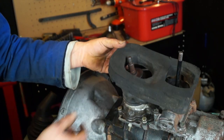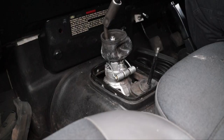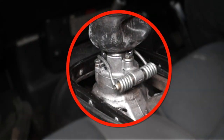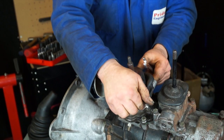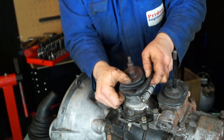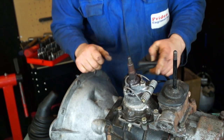Then remove the packing around the selector housing — this is just for vibration and noise reduction. We're only concerned with the gear selector housing, which you can access in the vehicle very easily. Don't use a sharp instrument when removing the rubber gator; use a spanner or something, then lift it out of the way to get at the selector housing.